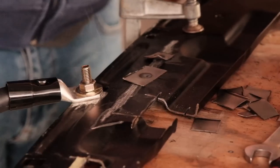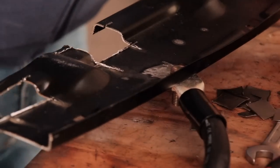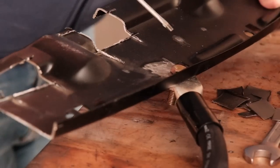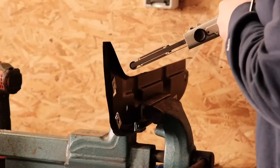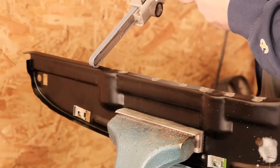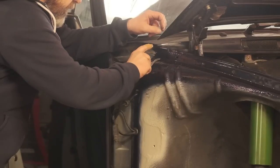It's rather obvious that the electrode will heat up the spot with the lowest resistance, and that means that there mustn't be any paint between the panels and the mass connection must be extra solid. I cleaned the according spots on the side panel, and at the car I had avoided painting them in the first place.